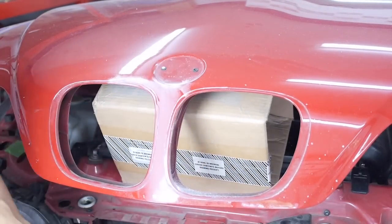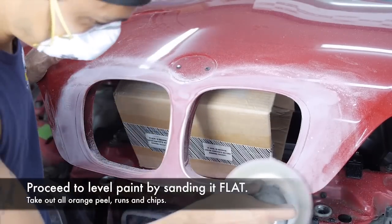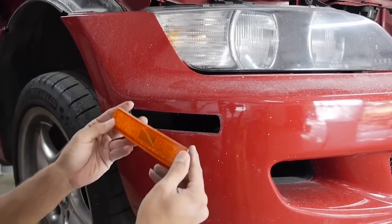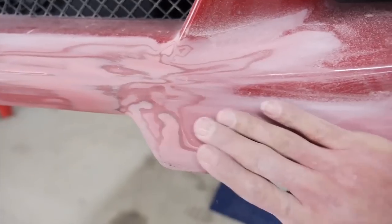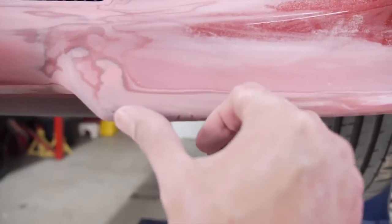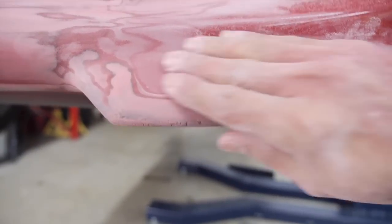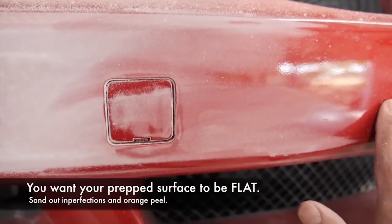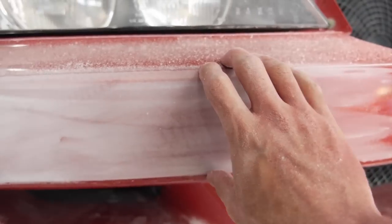You can see right away all the old clear and the high spots. All in here is done — there's a little bit of scratching in the plastic. What we can do after we primer it is fill it with glaze putty, water sand with 400, give it a quick coat of primer again, then sand it again. The whole goal of prepping before paint is you want it to look flat and matte like this — dull looking. But this is not a final grit; we want to finish with 400 before we paint.